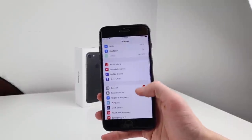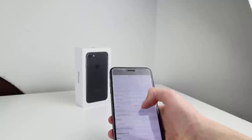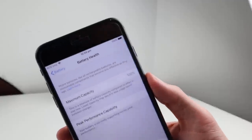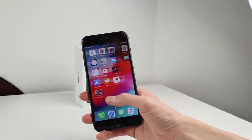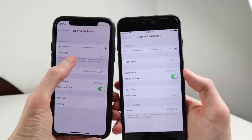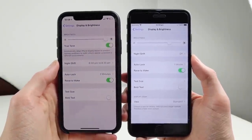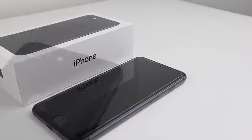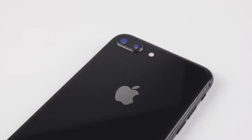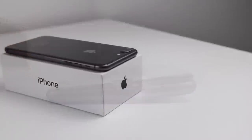So this has been an excellent deal for me and everything on the phone is fully functioning including the home button and rear-facing cameras. Yes, the battery health shows up at 100% in settings, and just to confirm this is a 64GB unit on iOS 12.1.2. However, there is one issue I can't fix and that is the True Tone function. As you can see the iPhone X on the left has an option in display and brightness for True Tone and that option is completely missing from the 8 Plus. That is because the display has been replaced and the phone knows it isn't the original screen. To fix this I would need to transfer the data across from the old panel to the new one, but I don't have the original display for this iPhone as the one that was on it when I received it was a replacement screen. So this is a small defect but either way for the price of the iPhone I'm not going to worry.